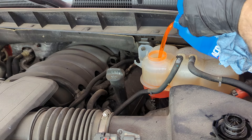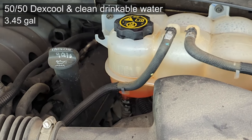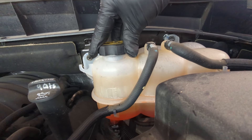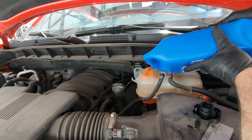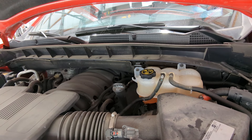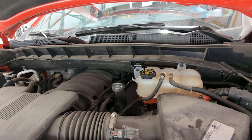I start it up, run it again — it pulls in a little more with that cycle running. I finally get the full two gallons of concentrate Dex Cool in, which is what I want. Then I can work on setting the final capacity with water, draining a little if needed, adding more water, and doing some more converter stalls.